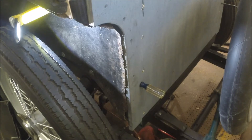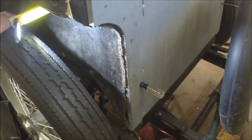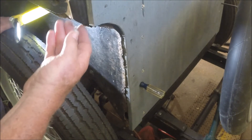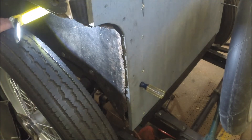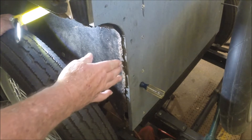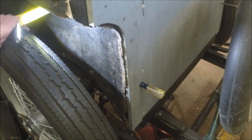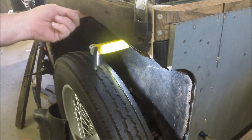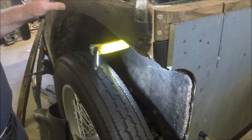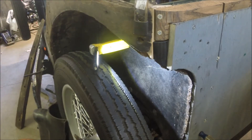I'm going to have to think about that — do we cut the old piece off and weld the new piece in, or do we make a new piece and overlap it? The right way is to cut it off. So what I'm going to have to do is make a template, bend up some metal, and see what I can come up with before we get too much further along, because we can't really nail anything there right now. We can go ahead and mock up the other pieces, but we'll have to pull these nails out from underneath the wheel well to get this piece out. That's the next step: put these two corners in and start working down to the hinge pillar.